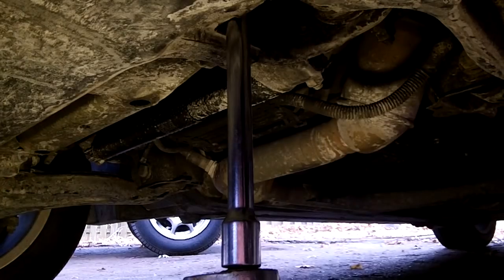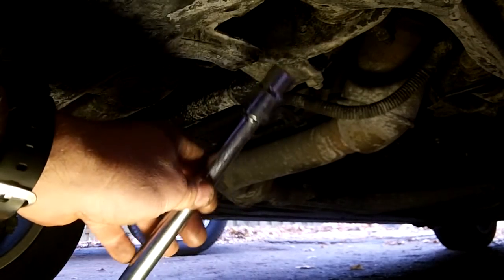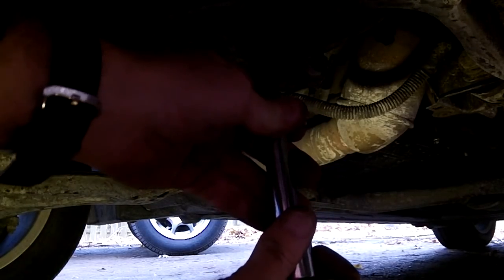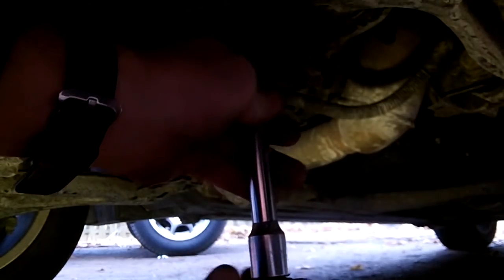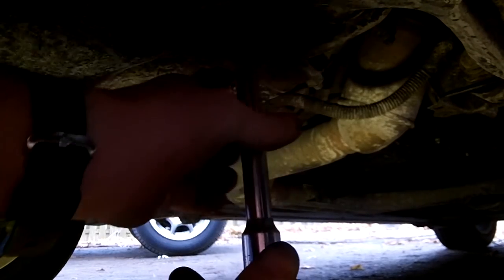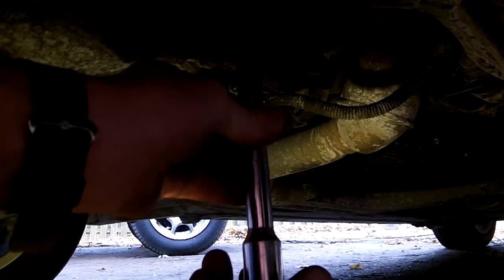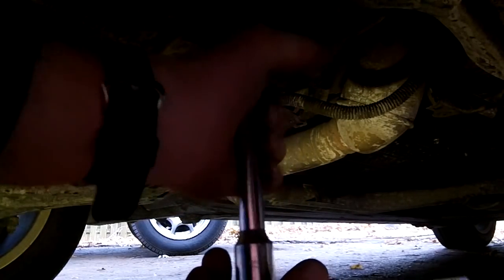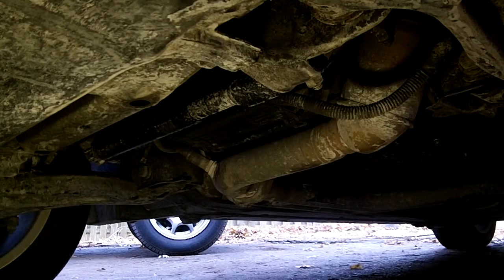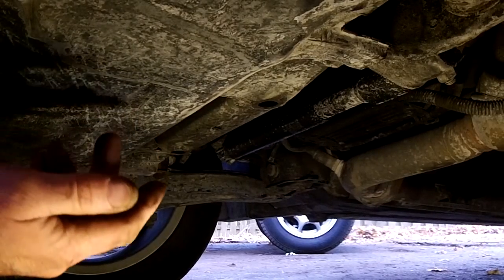Right now I'm doing the left side, the driver's side. Right here in the front control arm mount there's a hole — the 13mm bolt is in there. We're just going to take that 13mm bolt out — that's the lower mounting bolt for the engine mount on that side. I'm also going to have to take off the splash shield so I can jack up the engine, which is four 8mm bolts.